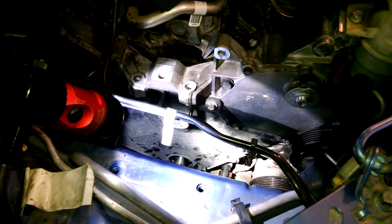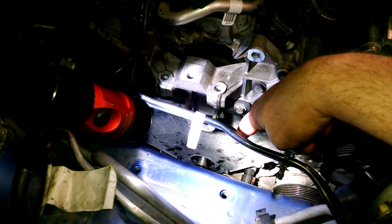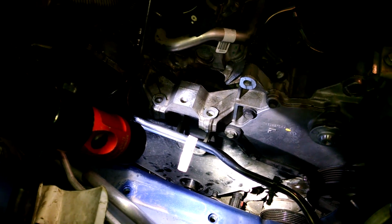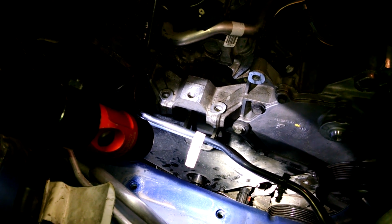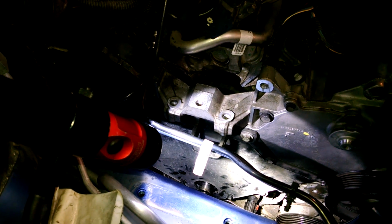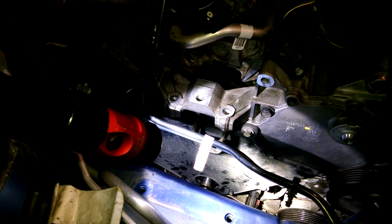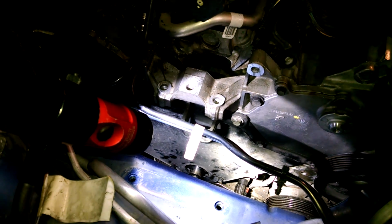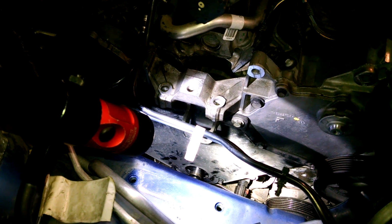So it's always a good idea to turn the engine over down at the crankshaft, turn it over twice, reline up your timing marks and verify they're good. That's the best time to find a problem, is before you put it back together. So when they're good, you can put it back together. If they seem to be off a tooth or two, then you can certainly recollapse the hydraulic tensioner if you have to, if you pulled the pin, which you probably should when you turn the engine over. So you might have to recollapse it, but still you're saving yourself some time versus headache down the road.